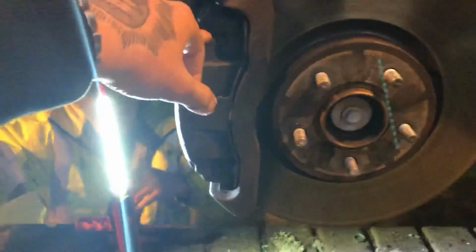Right, so obviously this bottom ball joint's got to come out, before Jack completely sprays me in the face. Track rod ends come off, clearly. I'm going to strip these down as well whilst we're here because I'm getting a bit of brake wobble at the minute, so check the sliders and that.